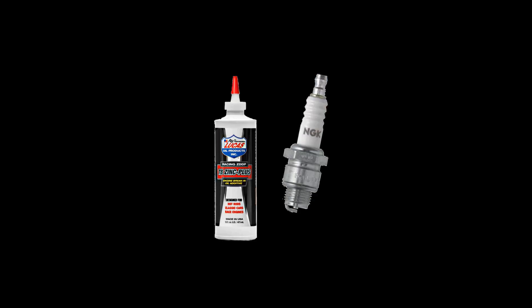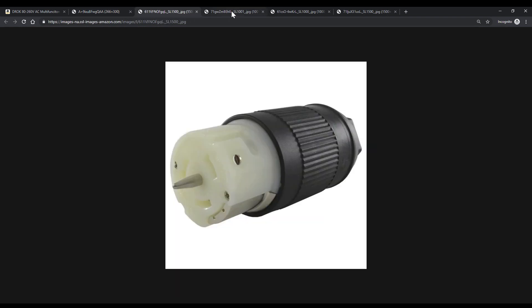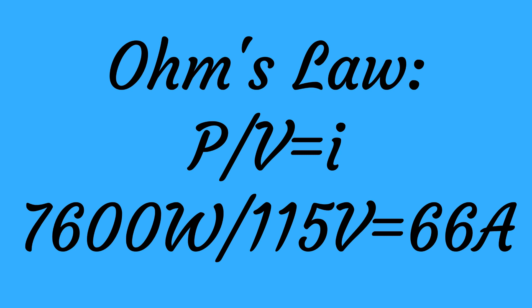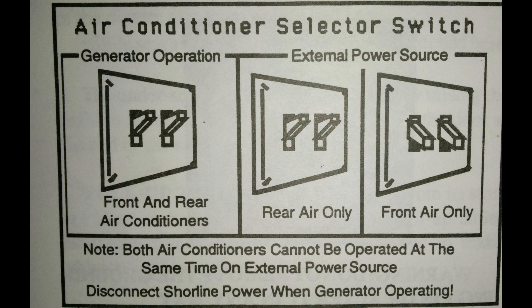In the next video you're going to see me unbox these and break them in — I'll show a little bit on how to safely break in a generator and make sure everything is working as expected. Then in subsequent videos I'm going to explain how to get these mounted in the motorhome, how to connect them into the existing wiring safely, what modifications we need to make, and how to set up an umbilical from the generators to the inside of the motorhome so you can monitor and operate them from inside without digging in the basement. These generators have enough combined power capacity that I don't need 30-amp service anymore — on 30-amp service I can only run one of my air conditioners, and my motorhome has been wired to only allow one air conditioner when on 30-amp service.